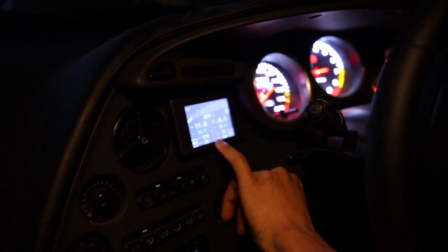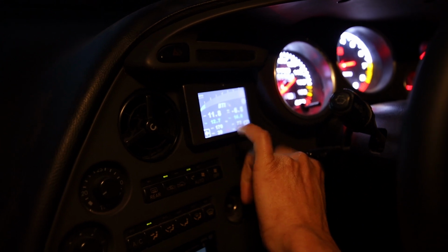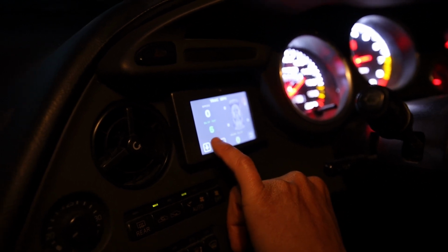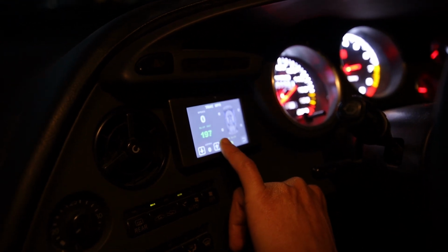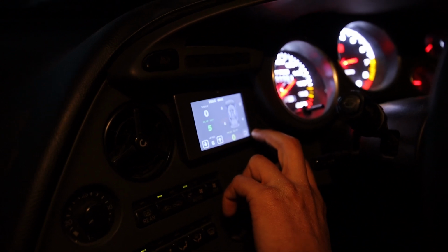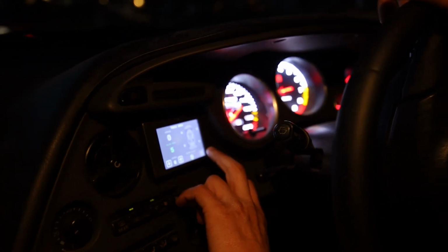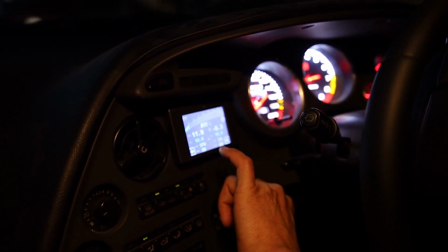So this car, I know we've shown it before, guys. This car has the BTI gauge. You can see the ethanol content, water, fuel pressure, air intake temps, oil pressure on the fly, or live. But look what I can also do on the fly. I can set up what level of traction control I want, right? So I can change the amount of slip allowed, which gets more and more aggressive. And then obviously 201 miles an hour slip means you're gonna die. It's basically off. I found that driving the car is actually really comfortable right around 5. It'll still move around and squirm on me, but it doesn't get away from me. And this obviously is not my car, so I'm not gonna go any crazier than that. And it'll show you what the wheel speeds are and the amount of slip as a peak value live. So these BTI gauges are sick.